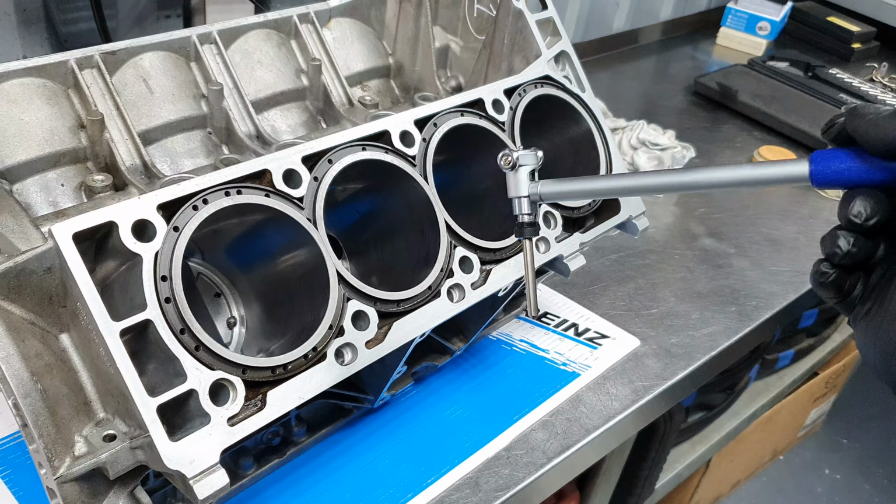What are you gonna do? Once again, even if you change only the piston rings, you remove the carbon, you change the piston rings, and you put the pistons again in the same position where they were when it was running. All right? You see that you have wear on the piston?